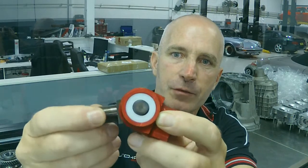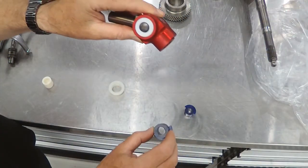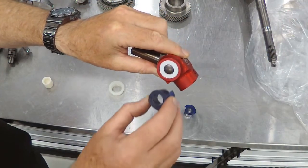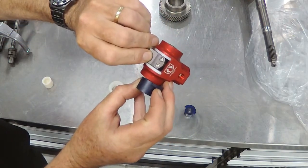The important thing is replacing a shifter coupling with new, tight bushes — suddenly everything feels much more precise and controlled. You might want to use a new shifter coupling as an easier alternative to replacing the individual bushings, which can also be done. We usually carry in stock aftermarket bushes in nolithane or polyurethane, which is a little bit firmer than the standard bushes.